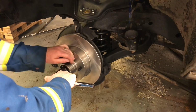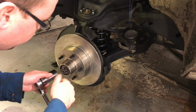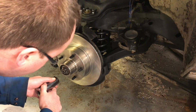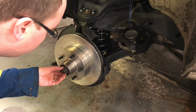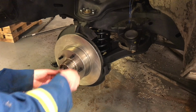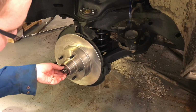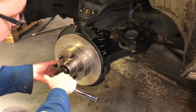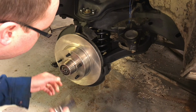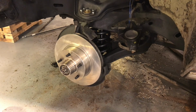Spin it back and forth a few times. And then once you've got it like that, then you just want to back the nut off counterclockwise till you can get the first cotter pin. Like, it should really be about finger tight once it's seated. Your cotter pin goes in. I'll put that in later, but you put your cotter pin in. So, like I said, have it tight. Not super tight, just kind of tight like this, right? And then back it off to the first cotter pin hole. And then your cotter pin goes in. And that's it. Thanks for watching.